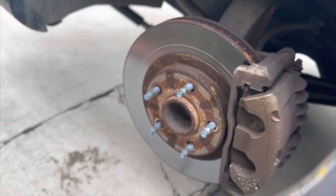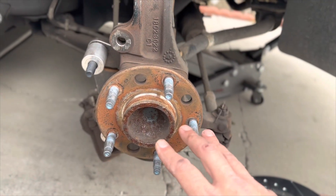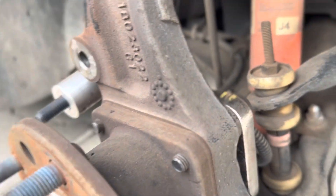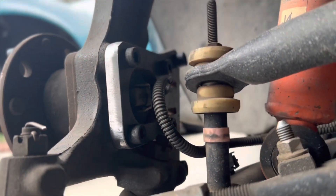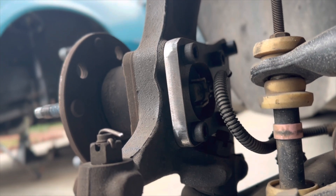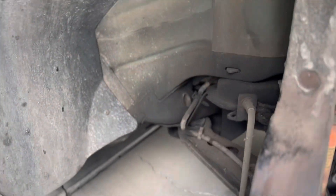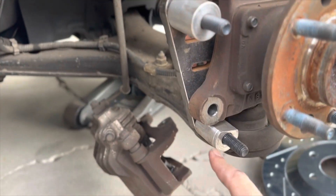On this side of the car we have the C5 rotor ready to go — it's a little bit bigger. You can see the same bolt locations where your caliper would normally mount, but this bracket is already mounted. These four bolts come in from the back. You simply unplug your ABS sensor, pull the four stock bolts out, slide the bracket on, put our four bolts in, and now this bracket extends off toward the back of the car.